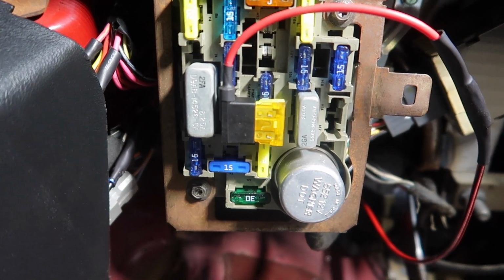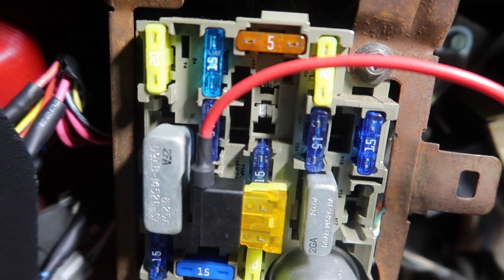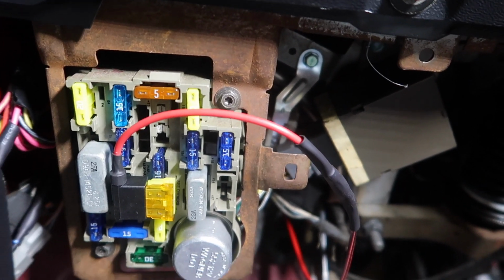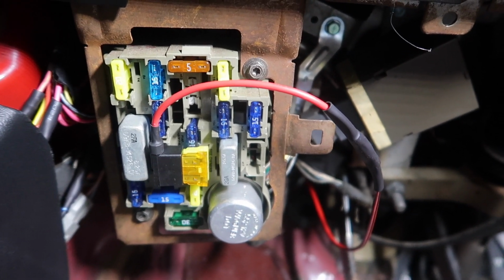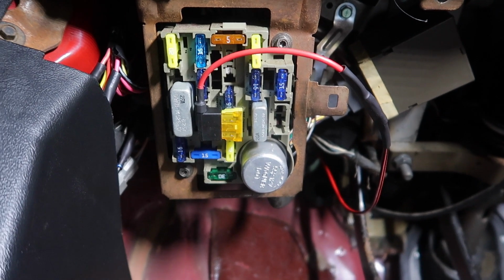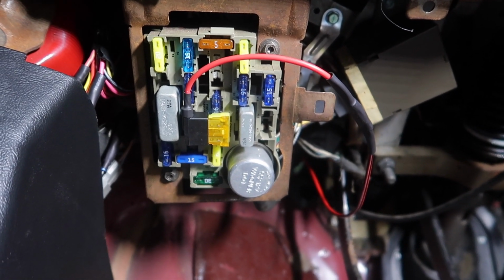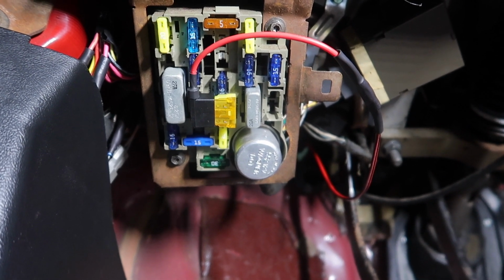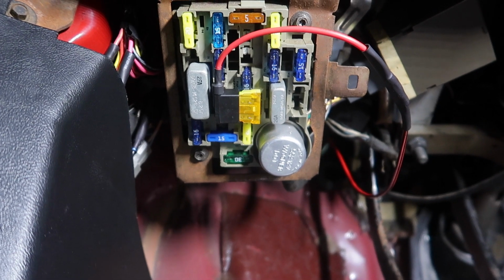I picked a slot with the 20 amp fuse, and I got two 20s ran on it because I tried to do a 20 that's being ran from the actual fuse, and then a 10 behind it, which is supposed to go, I believe, if I was understanding the YouTube video that I checked out on learning fuse taps, that the front slot is from the car and the back slot is what's going to the accessory, like whatever you're powering up through the fuse tap.